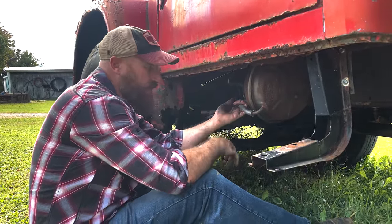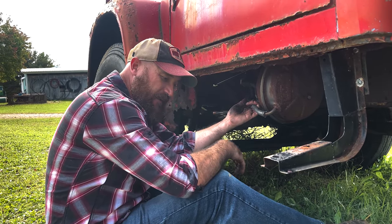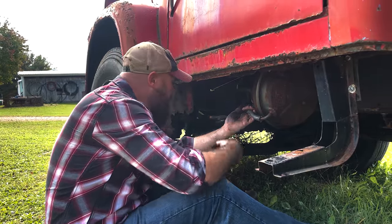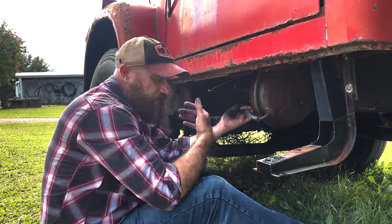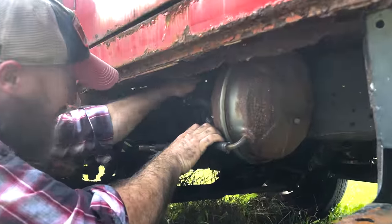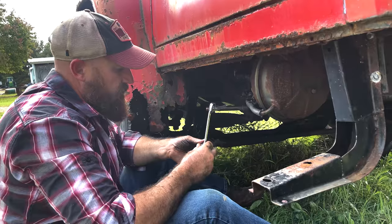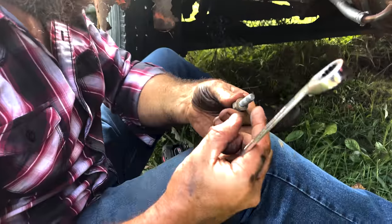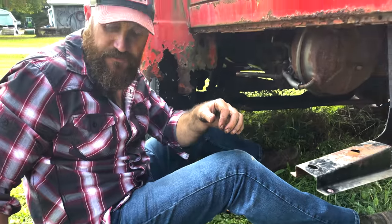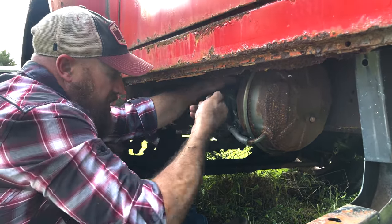All we need is brakes. We had a little bit of brakes. It was killing me because I just wanted to try to go, but I don't really feel like wrecking a dump truck. So we're gonna get this off. We're gonna stick it on the other one, see if we can't get home. Anti-seize in there, so I'm feeling pretty good about this booster here. Somebody must have installed this within the last, I'd say, 10 years.